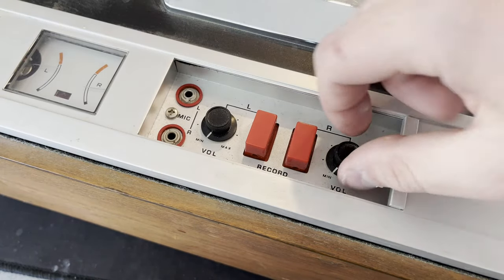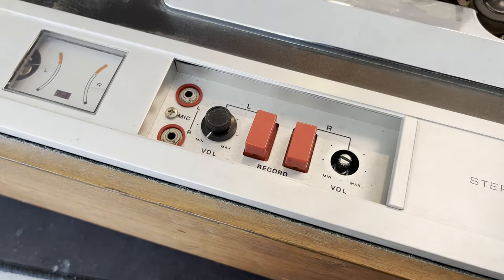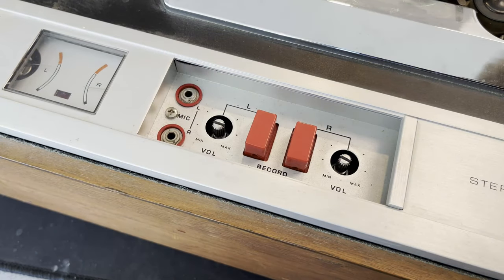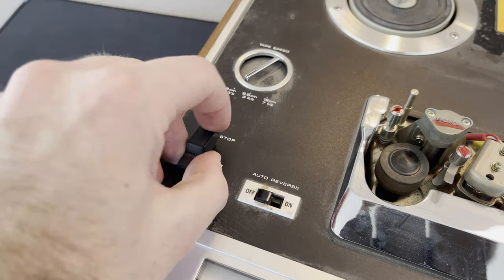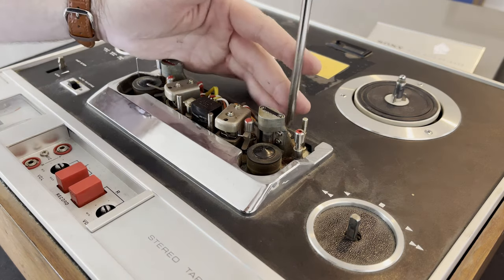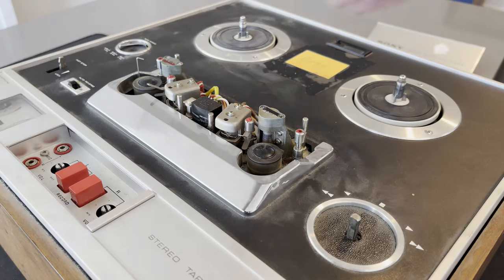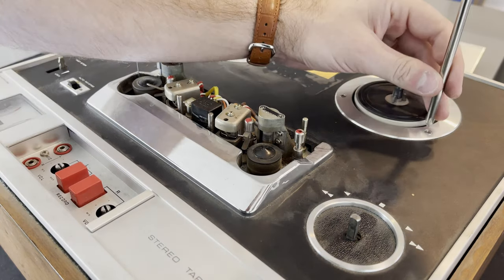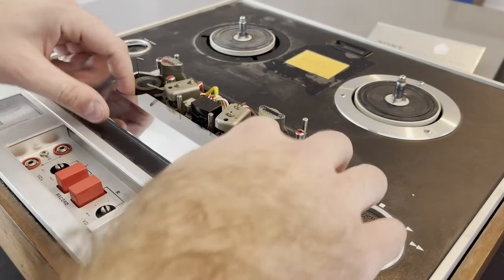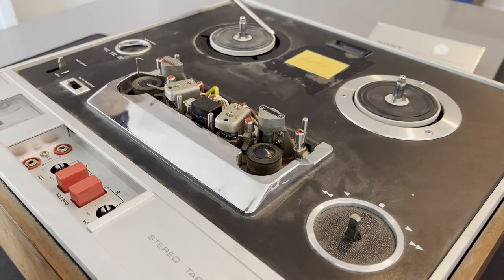There's a beautiful sliding drawer to reveal the recording controls. We've got to take all the knobs off and get the faceplate off this. Now it's just four screws and that's all it takes to get it undone. I later learned you didn't have to undo the bottom two screws for each of those wheels — you just need to unscrew the top one.